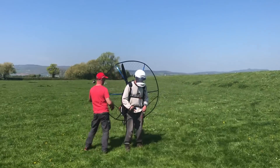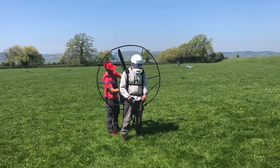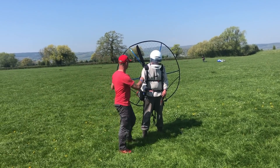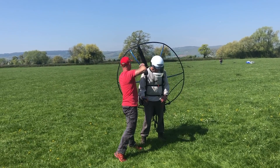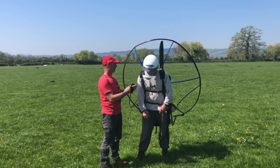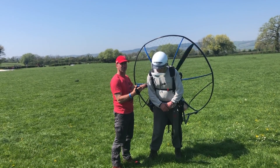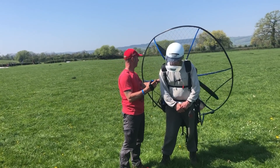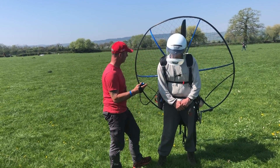This is interesting — it wasn't working. We think it might be the carburetor, even though we've done everything we could to rebuild it correctly. So we've swapped it with my carburetor — it's an identical one — to confirm if it is a carburetor problem or something else. It's not pumping fuel through. The prime's okay but it doesn't pump through.